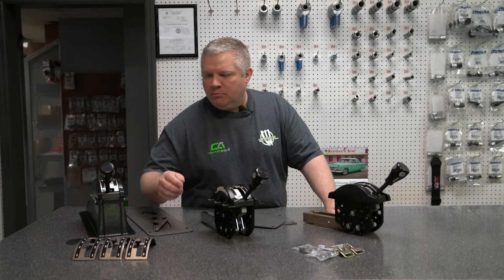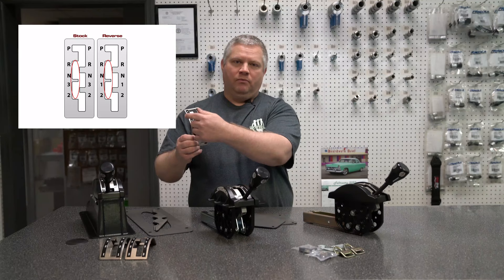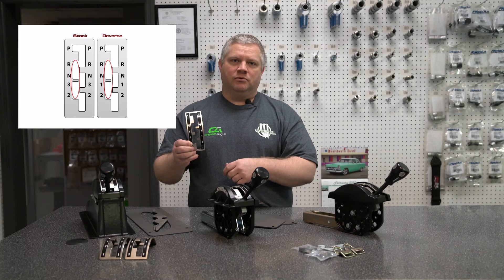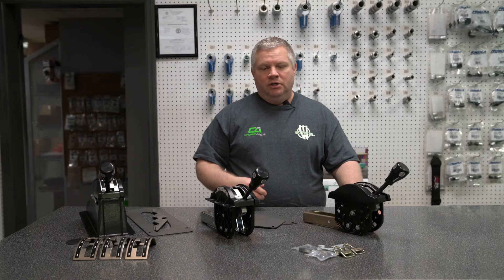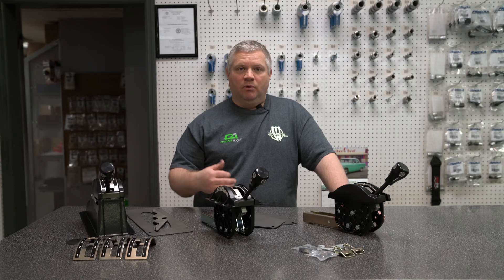A stock pattern gate has a gate between first and reverse, or third and reverse — you have to go around that to come in and catch reverse. For what we do off road, not the greatest, but it works really well. For a street driven vehicle, I'd suggest putting a standard gate in. If you have it in high gear, it can be knocked into reverse really easily if you're driving down the highway. So I don't recommend a rock gate for a constantly road driven vehicle.